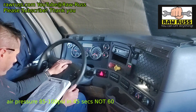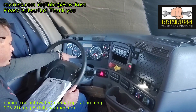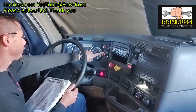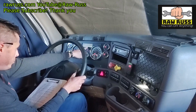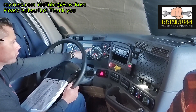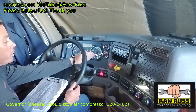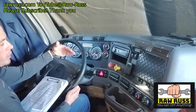We'll watch the air pressure build for both tanks. Check our coolant temperature — when fully warmed up it should be at normal operating temperature between 175 and 210 degrees Fahrenheit. We check our battery voltage and charging system. On manual Freightliners there's a black button; on these automatics you use the plus and minus buttons to scroll to battery voltage — 14.1 volts here; normal operating voltage should be between 12 and 14 volts. The governor should kick on and stop the air pump from filling between 120 and 140 PSI, or the level specified by the manufacturer.